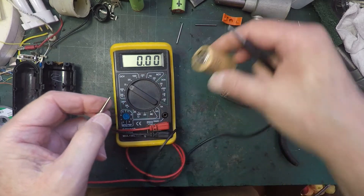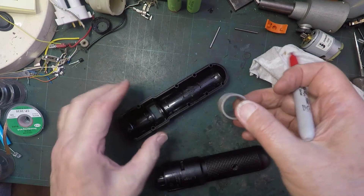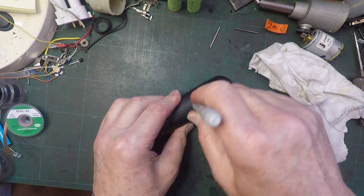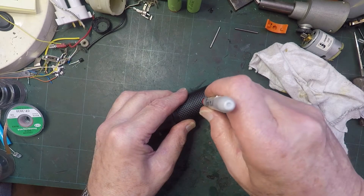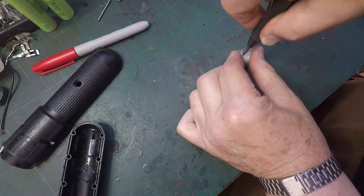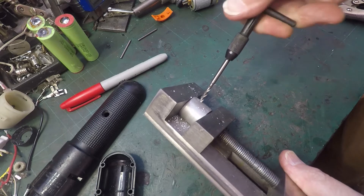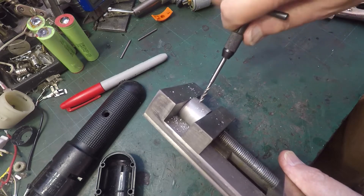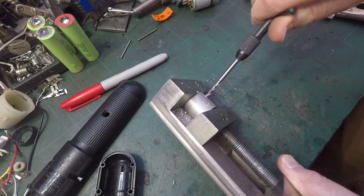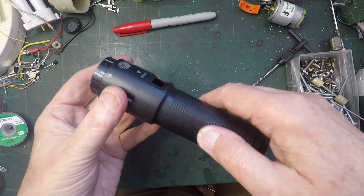Basically nothing. And nothing. Found this piece of aluminium. Not sure what it's from, but it's not a bad fit. That fits reasonably well. So if I mark in the middle... hole drilled. We'll just tap it out to M4. As it's aluminium, it's very easy to tap — or should I say it's very soft. Does that make it easy? I guess it does. Right, that's our ring in. And that fits on there.